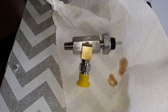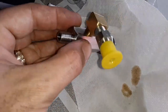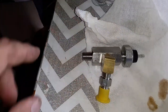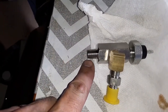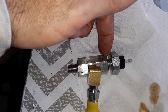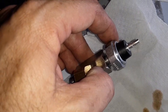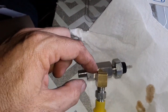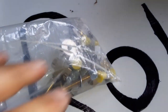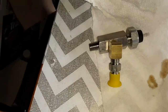Here I'm just beginning to dry fit some of my fittings together. This large hexagonal fitting is the one I got on Amazon. It's a one-eighth BSPT on this end, the same female on this end, and you can see I've screwed my oil sending unit into that. Then this outlet is one-eighth NPT — that's the standard pipe thread fitting, the type of fittings that come in the AMSOIL bypass kit.